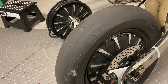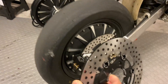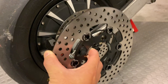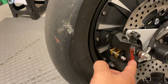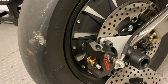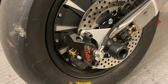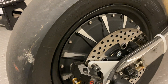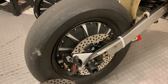With those done, putting a tire on there — I'm using a PMT tire here for a mini moto setup, but of course there are all kinds of 12-inch tires you can use. Then you need brakes: this is a generic 220 millimeter brake rotor you can buy on Alibaba.com, and then you need this little brake caliper. I'm using the RPM brand from Alibaba.com as well — they're pretty cheap. The caliper is about 30 bucks and the rotor is about 20 bucks.